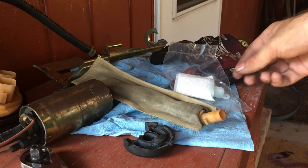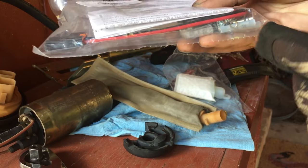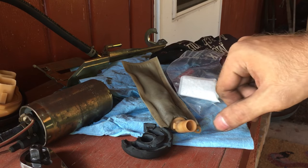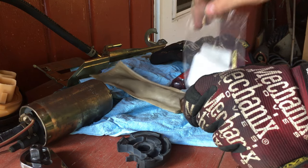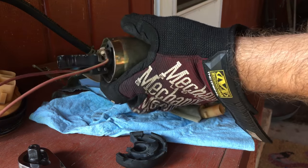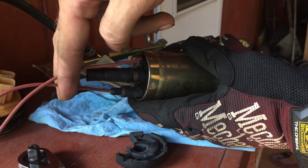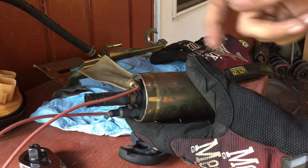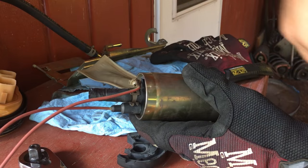So having this, the kit that I got does come with one more thing I saw in here. There it is. It's got one more one-time use clip. So I can clip it over there and still use this. But now, pretty much have everything taken apart except for the wiring. And I figure, since we'll keep this, I don't want to cut it to length yet. So I'll just go ahead and clip it right here. I'll leave a little bit of space in case there's some issue. If there's an issue with the Walbro and I need to use this again, I'll have enough space. If I end up clipping it here and there's a problem, then I'm gonna have issues. So just as a little precaution.